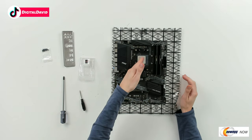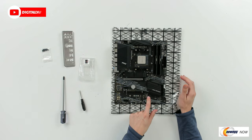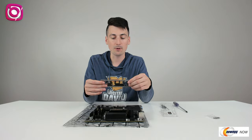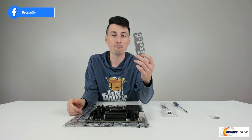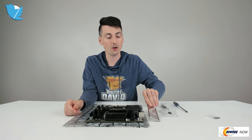So there we go. We have the CPU installed, our RAM, and our M.2 drive. On this board, we have another spot if we want to install another M.2 drive — you can do that right here. We also still have our I/O shield. We need to make sure that we don't forget this. Depending on the quality of your motherboard, you may have this separate or it's already integrated. I prefer to have the integrated ones because a lot of times I will forget to get this installed. So when we prep the case, we're going to make sure to install our I/O shield.